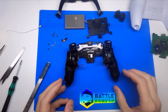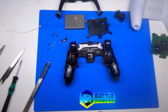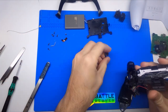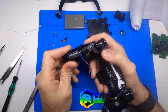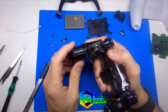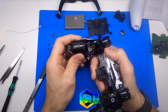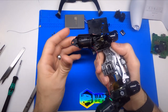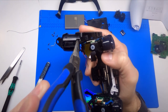The next portion, and probably the most exciting part of this controller, is the mid plate itself. We work with a lot of professional gamers and the number one thing they like to take out of their controller are the rumbles — and these rumbles are massive. They are not the same style of rumble as previous controllers, which were a rotating vibration motor. This actually has what I think is a floating magnet — you can feel it move back and forth. It's a very different way for the rumble to work, and it's not identical to what the Switch Pro controller uses either. Competitive players really just don't like rumbles and these are heavy, so if you want to take them out, there's an access point right here where you can see the rumble through the mid plate.